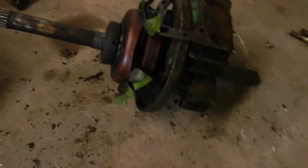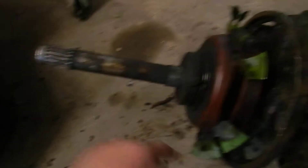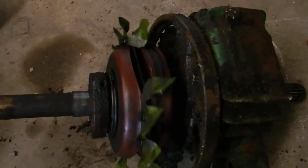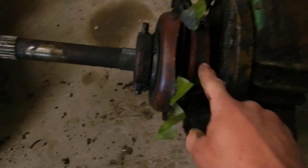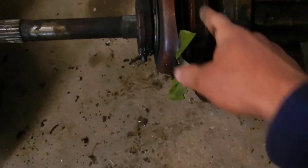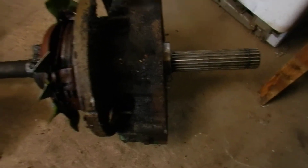Here's why we did this — here's the power booster. I assembled it back together just so I wouldn't lose any of the pieces. The clutch shaft goes into the bell housing and splines to the clutch. This is what kind of makes it work — you've got a set of clutch packs in here. When the clutch packs are applied, that's what gives you direct drive. And then it ends up going to the transmission by the input shaft.